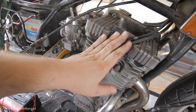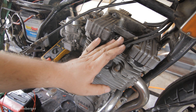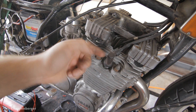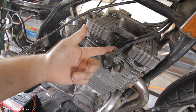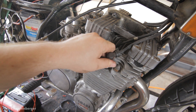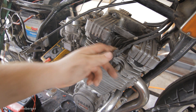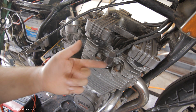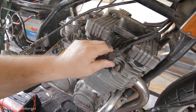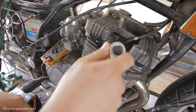Without going around guessing and checking ignition coils and stuff, because as I just found out myself, I tested the ignition coils on this and I did a secondary test through the spark plug wire and I got nothing. But as you're going to see here, I did actually end up getting spark. What really made me think about this is I pulled another set of coils off another old bike I had — I also got nothing through the secondary tests on them, and I know those coils work. So let me show you how to really test for spark.